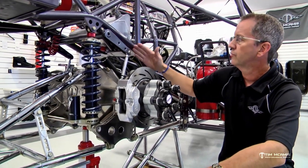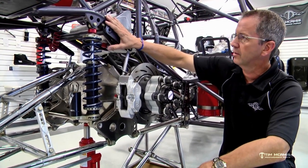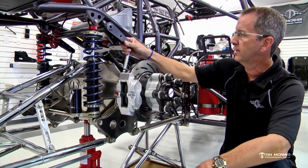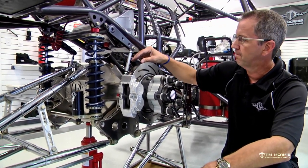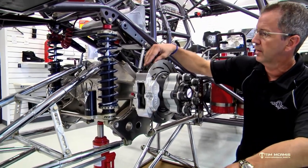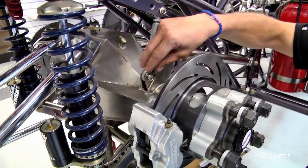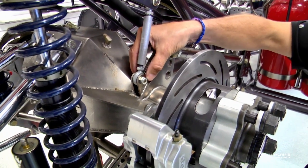Once it's installed, you want to make sure it's very solid in the car because it needs to detect any movement in the housing at all. The links need to be as close to the actual centerline as you can get them — somewhere around the four-link area. They need to be attached with some nice heavy tabs and don't need to be very long — the shorter the better to keep any flex out of them.